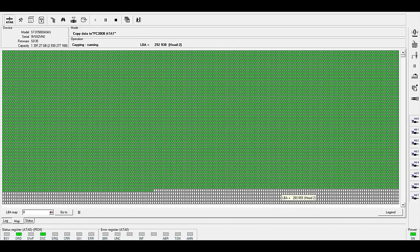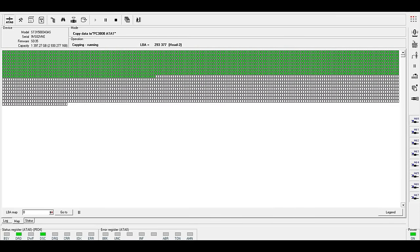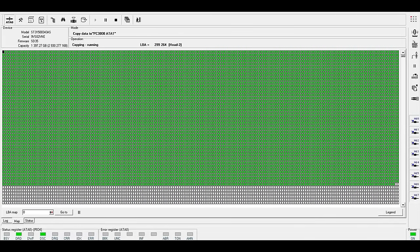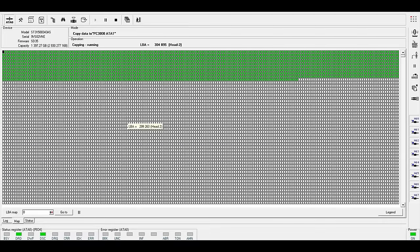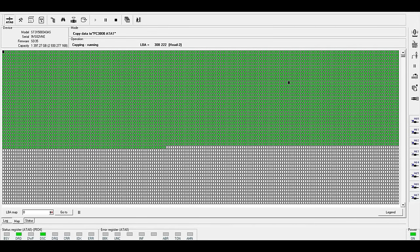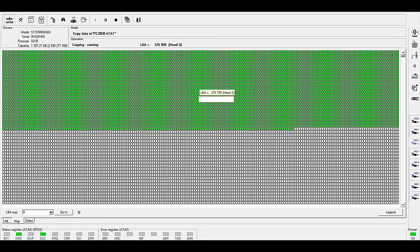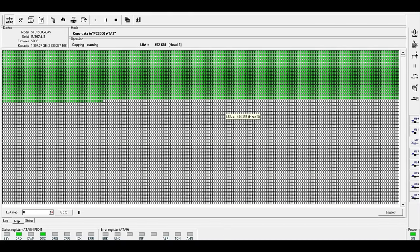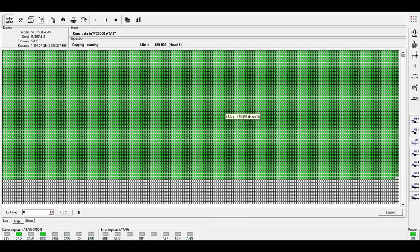and we've run into a slow area of the drive. More than likely going to get a bad sector here at some point. And there's one located there. So this is head three that's actually causing this issue right now. Oh, it's gone into head two. Let's have a look. Which head is doing this? Head two. So what we can do to stay away from this area is I can actually disable head two. It's now skipped it and moved on to head three and started cloning. So this is a valuable tool for recovering data from a drive that's traumatized, where read-write heads can be selected.